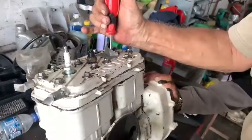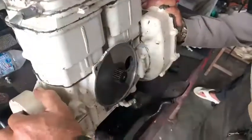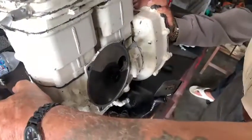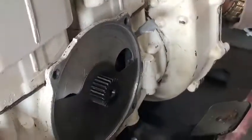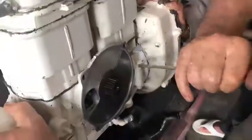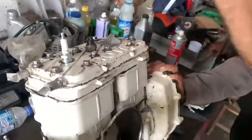Up, ready to fire — firing. And in the meantime it's still sucking in there while it's firing, and on its way down it's closed again. So the pressure — it all goes quite fast — closes here, gets compression in the bottom case, and comes to the top again. That's why it's a two-stroke.